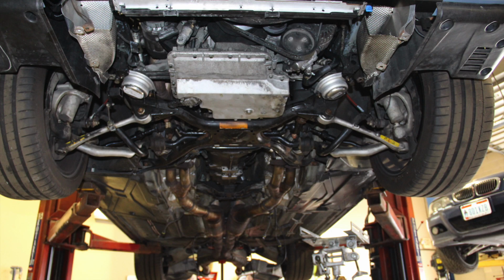So it's really hard to tell on camera with just the microphone of a Canon DSLR camera. There was, in that start, and that's the only time I've heard this engine start, there was minor Vanos rattle on startup for like 3/4 of a second. It's been rebuilt by Dr. Vanos. This system just needs to wear in, be broken in, get some oil circulation with some oil pressure more than idle, which is, as far as I know, at this point, the only RPMs this engine has seen.